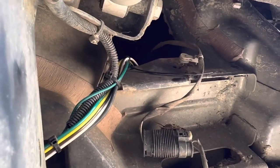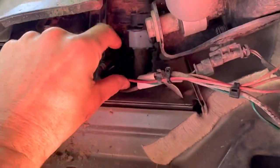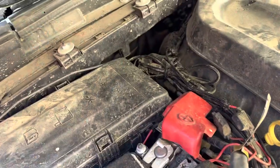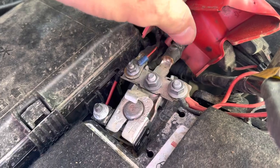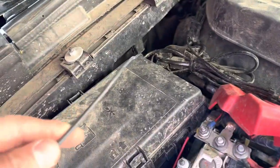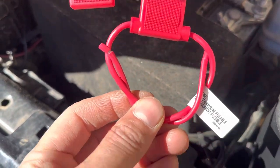The biggest thing left is getting the wiring all straight — I usually try to follow a factory harness. Since we have an aftermarket muffler, this whole space is wide open, so we ran the wires behind the heat shield, came out, and followed the factory harness up. We'll run the power wire all the way to the frame and along the frame up to the engine compartment to make the connection at the battery. Once up there, we connect to the positive terminal — this wire was fished up from the frame all the way from the back, and they give you plenty of wire.